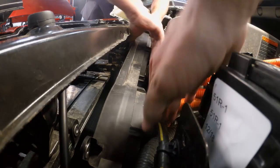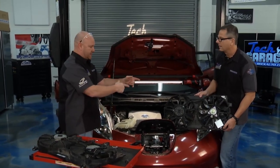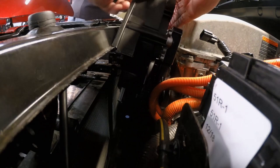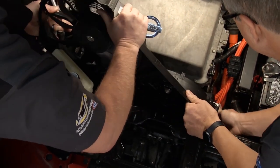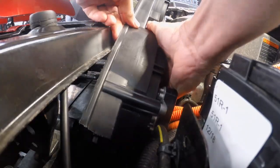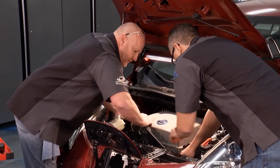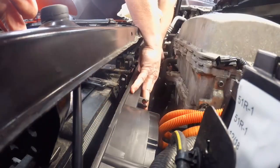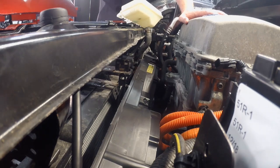Just pulling that one up out of there — it looks like it's a little wedged, so we're going to step it out this way. Now, you always want to take care of the back of that radiator; if you're doing this by yourself, put cardboard on the back of it. But there's no shame in our game — we've got a second set of hands. I've got it plugged in already, Brian — just bringing it up and over, rolling it down. Back in the same way it came out. Watching that radiator — we've got these high-voltage wires right here. Two 10-millimeter bolts, sit it in the channel. Maybe a little dielectric gel on those connectors — it's down in the weather and road grime. We'll get this thing buttoned back up and it's going to run like a champ.